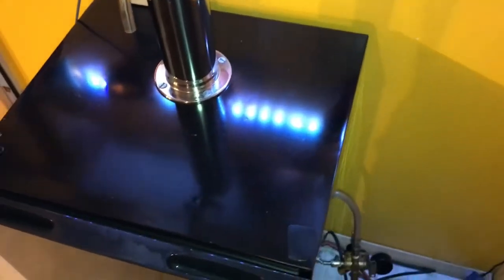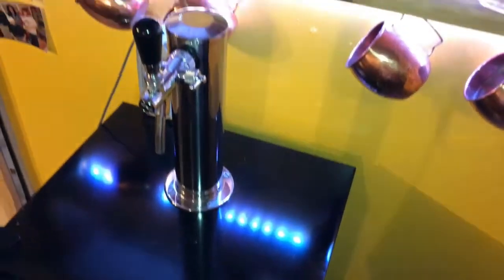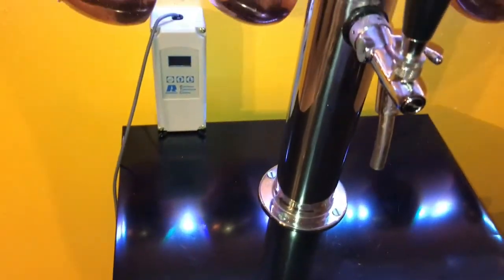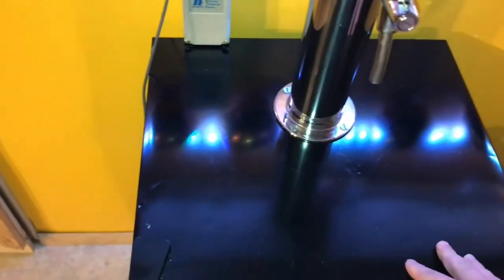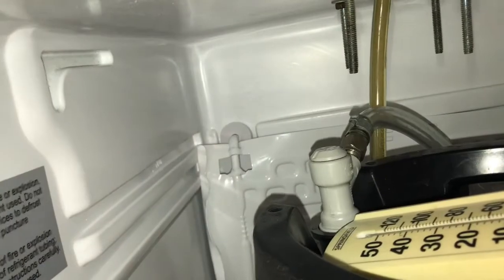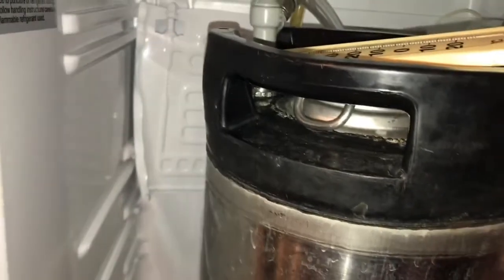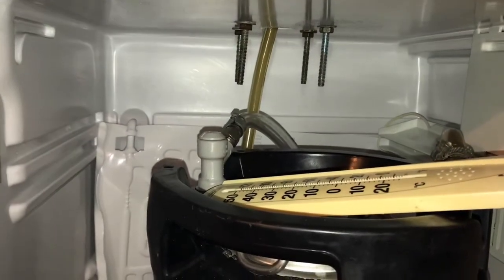And I left it on for like an hour, maybe 45 minutes. And the temperature controller never changed. It's not on right now, I have it unplugged. It stayed on 55. And this thing is not that big for the sensor not to pick up anything. And that plate in the back, where I assume the cooling comes from, you see up there, it runs through that and freezes it or cools it down, and then it cools down the rest of this fridge. Yeah, it wasn't getting cold.